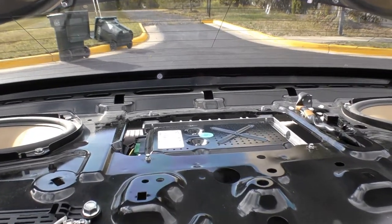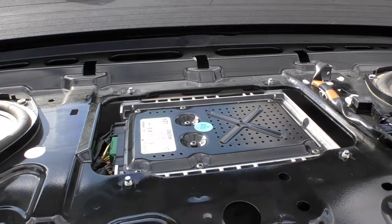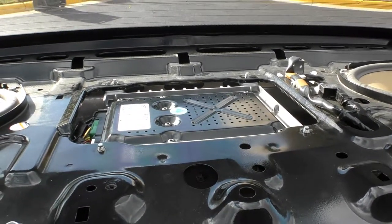A small life hack: you may install this amplifier from the trunk with no problem, so in the future it's going to make your life easier. If you found a replacement that looks like yours but has a different part number, it won't work correctly because it has different output connections and different output levels. So it's always a good idea to get your own repaired.